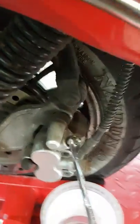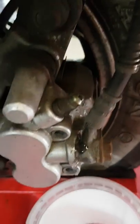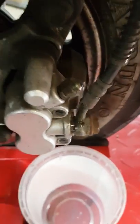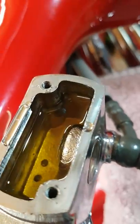As I said, the fluid in the pipes is not going to be clean. Normally I would use a machine, but you won't have one. If I crack this open and push it downwards — you can see how quickly it's dripping through and that's just one little crack. It shouldn't be coming through that fast, so I undo it a bit more. You've got to rinse it off afterwards. You can see the fluid is going down really quickly, so I'm going to grab some new fluid and tip some in. I'll try not to overfill — just up to the fill mark.